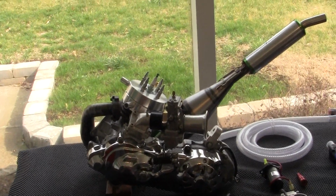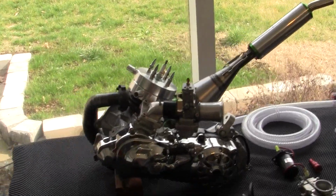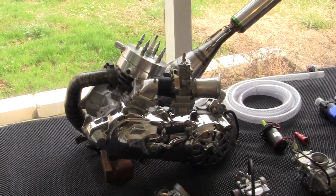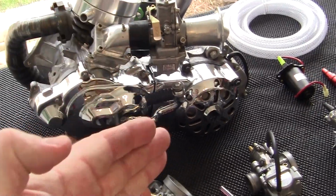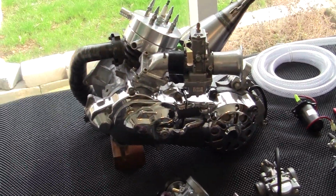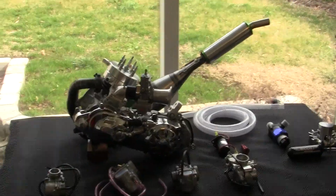And yes, Grant, I have a bunch of these steep ramps. I don't use them. The ramp plates for the variator come in a low rise and a steep rise. I use the low rise. My power band is better for me, it being in my advanced, really cool age. Okay.